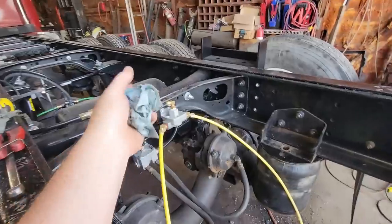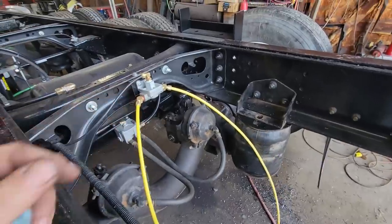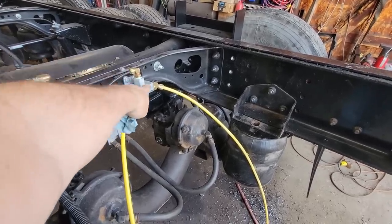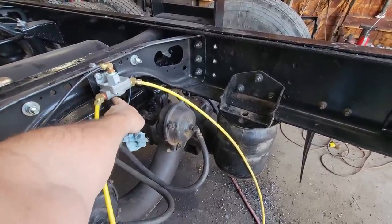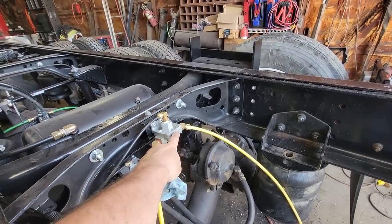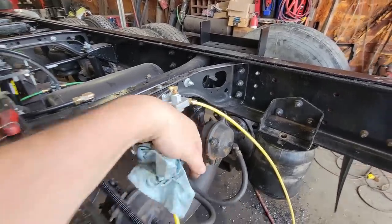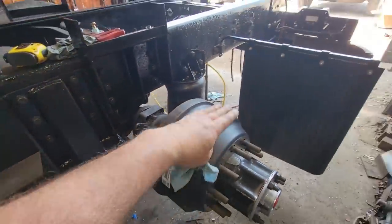All right, so there you go. There's the proof of concept of how it's going to work, even though it only had the exhaust of what was in this loop. You see it just comes out and goes right back in, basically taking the place of the two airbags. But like I said, you're supplying it with a small volume of air coming into it, so it has to overcome that spring. When it overcomes the spring, it pushes down, covers this, seals off the exhaust, and lets the airflow to the bags. When you remove this air pressure, now the spring takes over, because there's more pressure on this side, so the spring takes over, and it will push up, and this pressure will push up on the diaphragm and exhaust, and we'll get it pretty well exhausted to this state, because our coil springs are going to lift it.